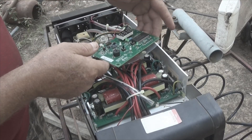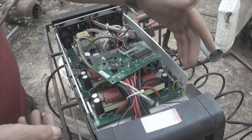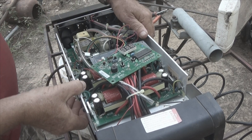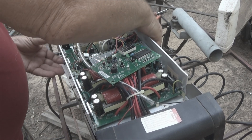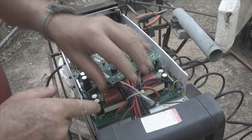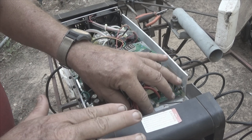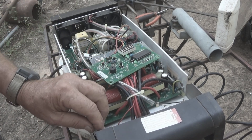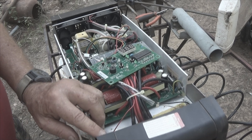This is the top panel that I talked about — removing the four screws from it. There are two screws here and two screws here, and this plate will lift straight up. I'm going to do this off camera because I need to move the camera. These wires right here are going to create a bit of a problem. I'm unable to remove this back panel because it has a plug in it and there's no way to remove this plug.